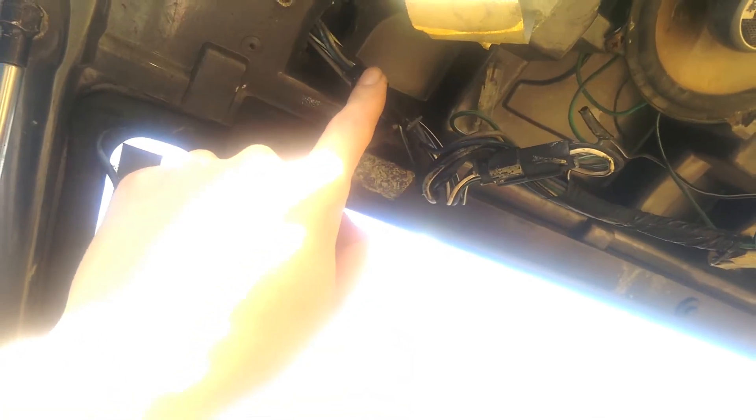The only thing I could figure out was that the gray wire coming from this end of the switch going all the way over to the connector did not have continuity. So there's a break somewhere in the gray wire going from here to the tailgate. That's the issue I've been trying to figure out — tracked it down to that gray wire being broken somewhere along the line. This wire here is hooked up to the ground side of the light bulb, acting as a jumper wire in place of that gray wire.